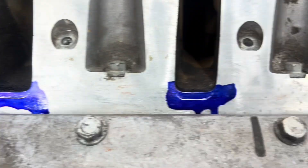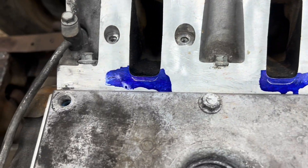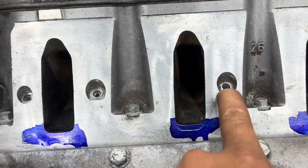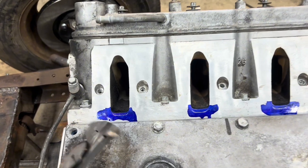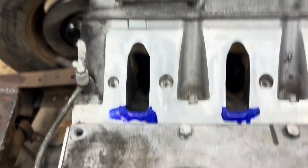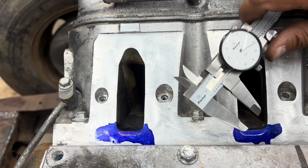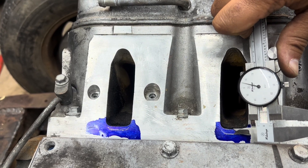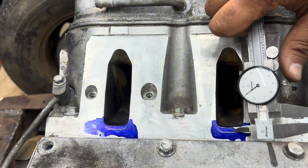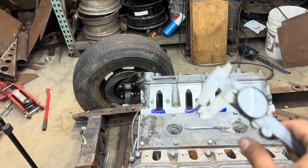As you can see, my mark is there and it's relatively consistent. I made the holes in my intake seven millimeters, and these are M6 bolts that hold this on. I just wanted to leave some wiggle room and it's simple enough to look down the ports and make any adjustments if I'm off a little bit. I'm going to get my caliper here — that looks good right there. We're about five millimeters off, so I'll just go into the CAD software and move those bolt holes down just a little bit.